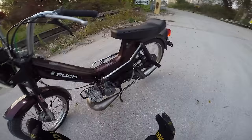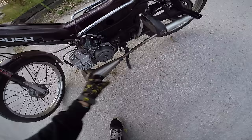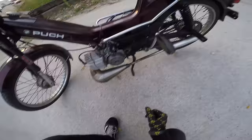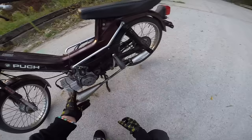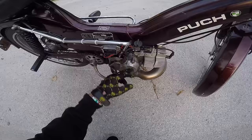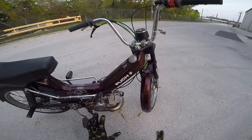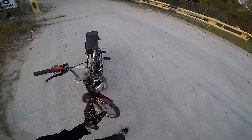In there I basically cut out a lot of the stock wiring harness and made my own — reused a lot of the wires but it's still super janky. Some wires are way too long, all stuffed under there, loose behind the headlight. The Power Dynamo makes so much more power, the lights are way brighter, the response is so much better, and it actually wasn't that hard to tune — only took us one install attempt. Normally you put it on, check the timing, take it off and rotate if it's off, but we got it first try. The regulator for the lights and the new ignition coil are on this side — wires are just zip-tied everywhere, nothing professional, but hey, the bike runs.